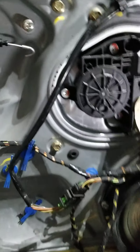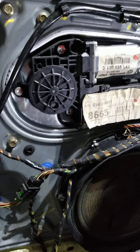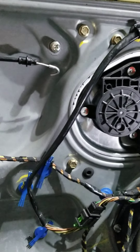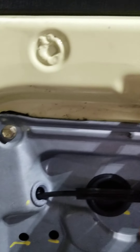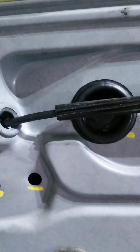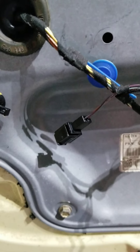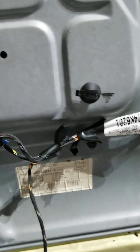What I did today is a regulator on a 2006 Volkswagen Beetle convertible. The convertible is different than the coupe, which a lot of the videos don't tell you. The big difference is a bolt here and underneath the speaker, and a bolt here and again under the speaker. These underneath are slotted so you can adjust the window back and forth — that's the front and back.